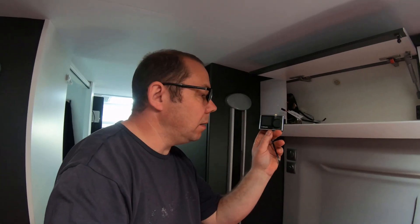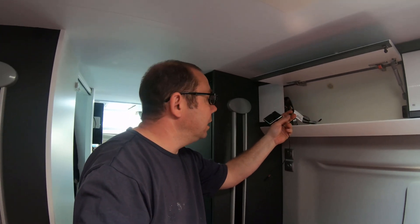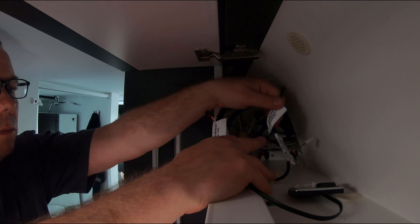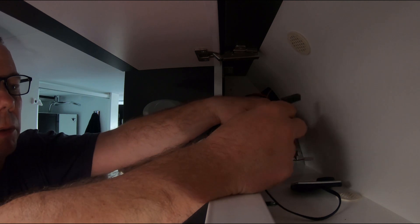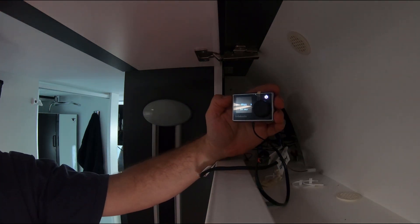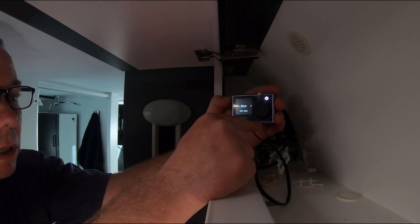Before I put that front panel back, I'm going to connect up the new control panel onto the diagnostic connection and give the heater system a trial run before I put everything back — because if there's anything wrong I'll have to take it all back out again. All I need to do is make sure I've got the right wiring loom with the ThermoCore Diagnose connector and plug the two together. When I plug it in the new control panel just lights up straight away, and then we can go through the instructions to set it up and make sure the heating system works okay.